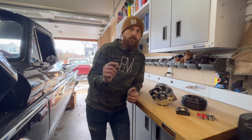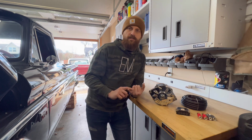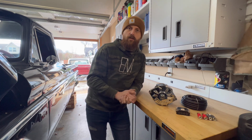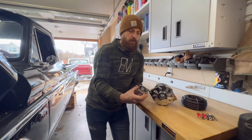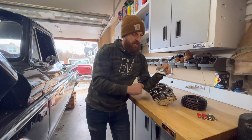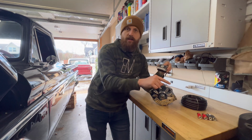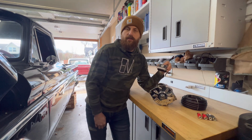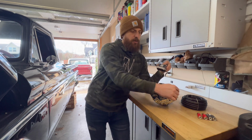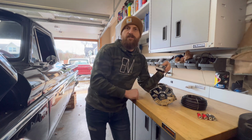Right now, the wire that runs from my battery to my alternator has a split in it that runs my headlights and all those other things up front, the fan and all those. So what I plan to do is run 4 gauge to this splitter, and then run the splitter to the alternator, and then have one of these running to a relay for my lights and other things. Kind of the same way it's set up now, because I thought, why run 2 different wires all the way to the battery when really it's going to be pulling from this charge anyway.